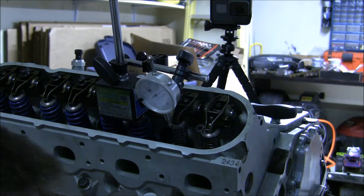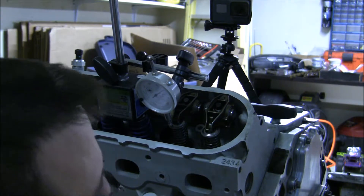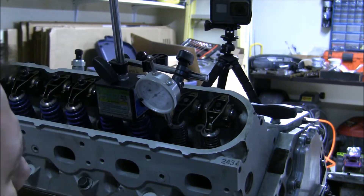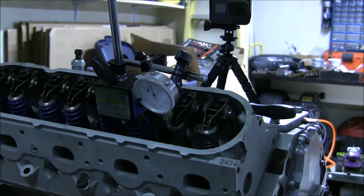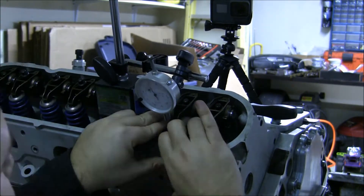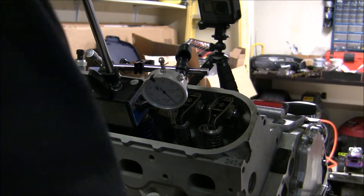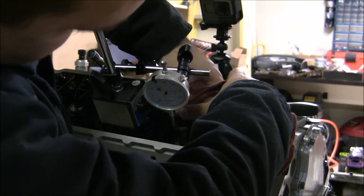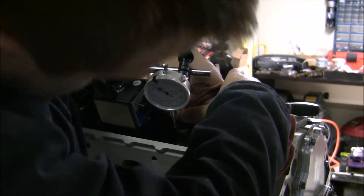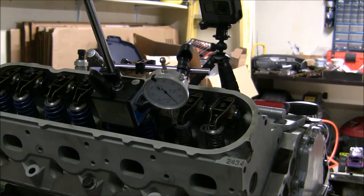Alright, so now we're at zero again. The exhaust valve is opening or closing, so that means the intake is completely closed. Let's try this again and see if we can measure the intake side. Now that I've got everything set, I'm going to try this one more time — I have the intake valve where it is closest to the piston. Let me try again and see what I get. One, two, two, five — four, five, I'd say. So that's the closest I got. I reset to zero.